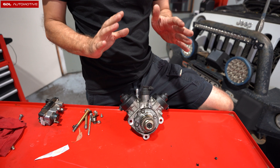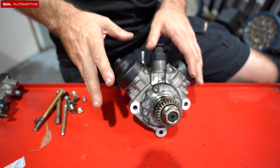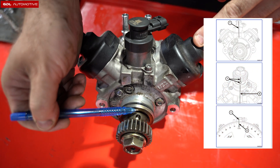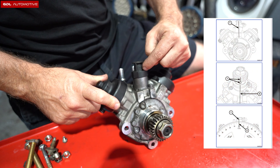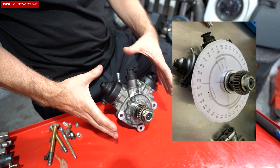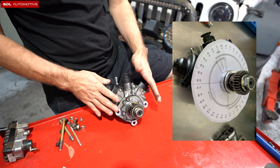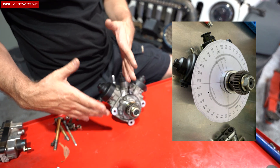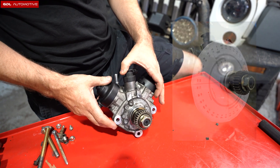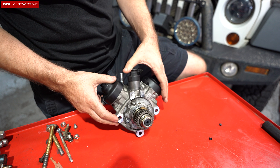Step one: you need to have the engine at 65 degrees after top dead center, not on top dead center. You then need to get this fuel pump timed — this little hole with this solenoid here. Then there's a timing wheel that the dealership will give you in the workshop manual, and you need to retard the fuel pump by 60 degrees. We'll show you a picture here of what that looks like, courtesy of Canberra SRT and the guys down there who gave us this information and then corrected us when we got it wrong.